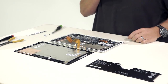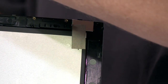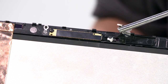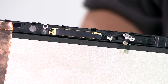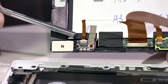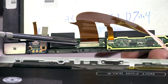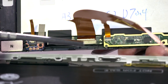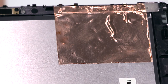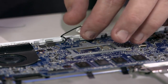On the display portion of the tablet PC we have magnetic pieces on all four corners which work to hold onto the keyboard, along with a front-facing 1 megapixel camera with an Exmor R sensor. It also houses the camera connector to the motherboard. The bottom left is the charging connection for the keyboard, the video panel connectors, connector tape for the Windows button, and special copper tape which marries the fan once the unit is shut to help dissipate heat. Along the bottom are the wires for speaker 1 and speaker 2.